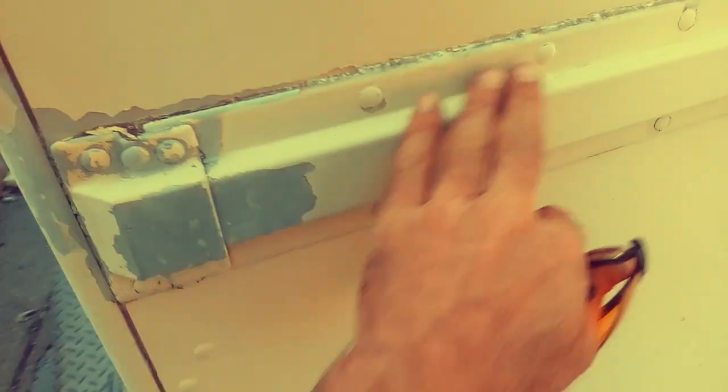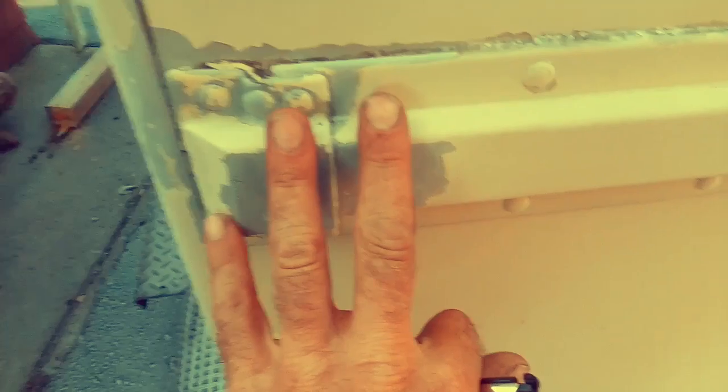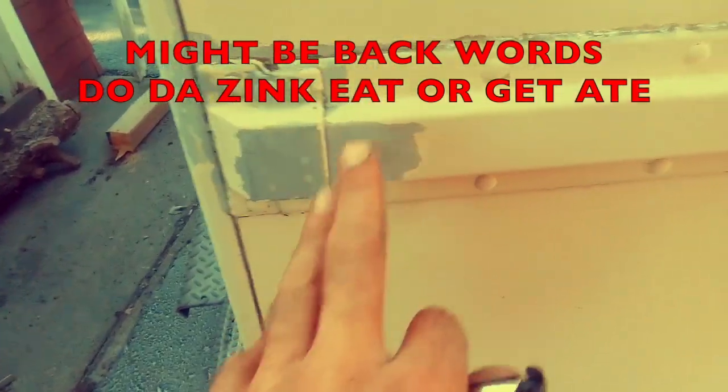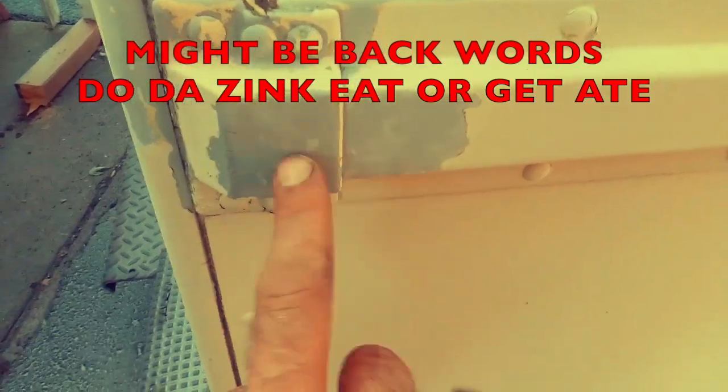You can see how it's cleaning up the aluminum and magnesium — see how it's not pitting it. It was already scratched, but you can see it's getting cleaned underneath. When this vehicle was repainted, this wasn't done properly. So I'm going to strip it by hand and then go over it with the soda blast, because I need the soda blast's alkaline action to get in here. Magnesium will just destroy itself if it's not chromate-treated afterwards or immediately blasted with the alkaline.